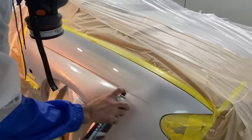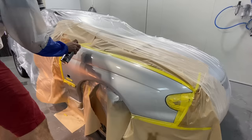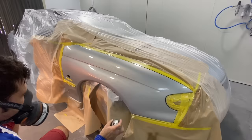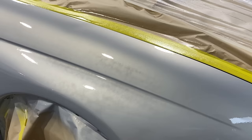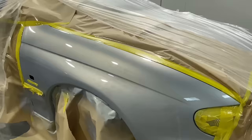I'm spraying three or four coats, waiting 10 minutes between coats, overlapping by 50%, and keeping the can a good distance from the panel — not too far away, not too close — getting a nice wet coat on there. Now I've got these stripe lines visible — that's just the solvents drying. Once the clear dries they will completely disappear. Looking pretty good.